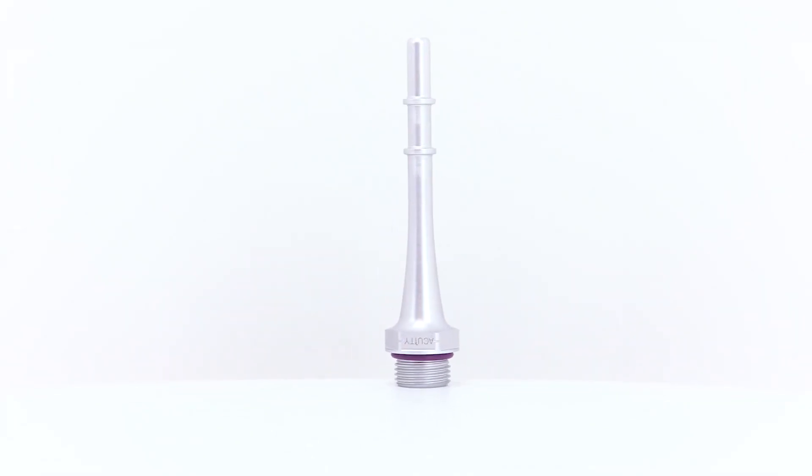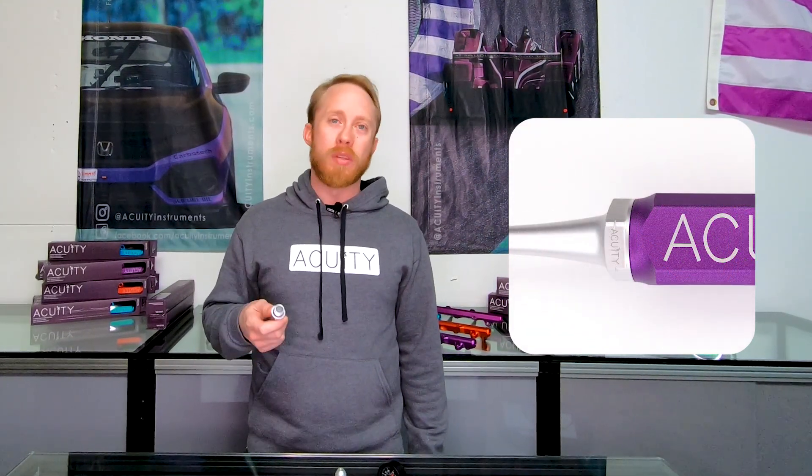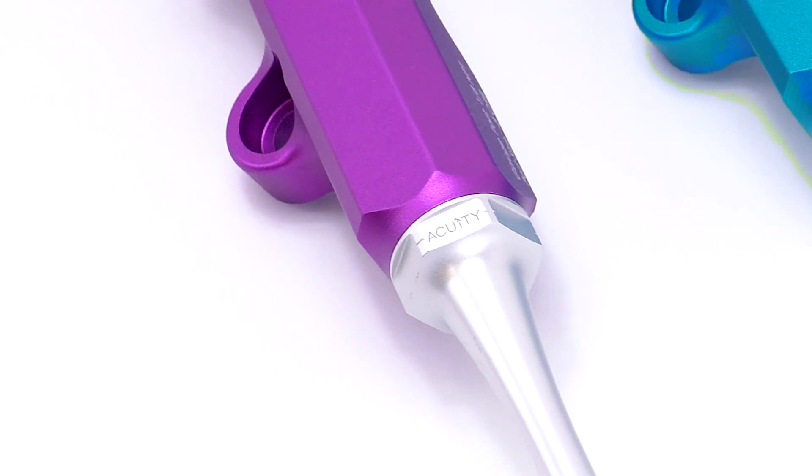Next, let's talk about all of the Dash 8 O-Ring boss fittings that fit into the end ports and center port on the rail. O-Ring boss fittings seal by using an O-Ring that's pre-installed on the fitting. What to look out for when installing these is a gap between the flange and the port it's being threaded into, or after you've pressurized the system, any part of the O-Ring protruding out of that gap. If you can see the O-Ring starting to come out when the system is pressurized, you've installed the fitting incorrectly and insufficiently tight. You need to depressurize the system, remove the fitting, inspect the O-Ring for damage, replace it if it is damaged — but you can reuse it if it looks good — and then reinstall the fitting into the port such that the flange bottoms out on the port itself.